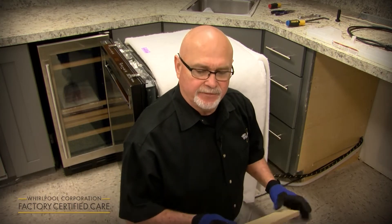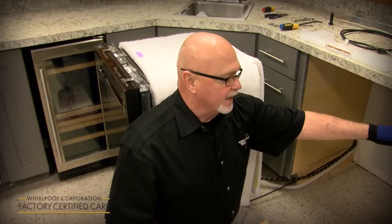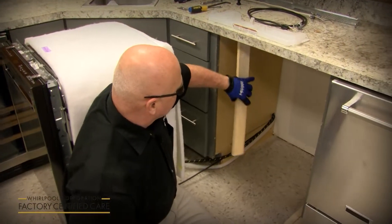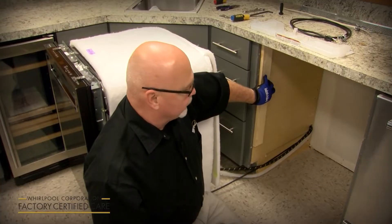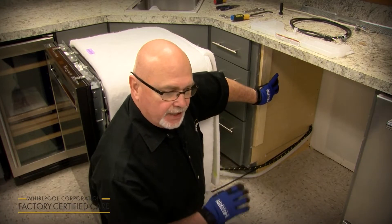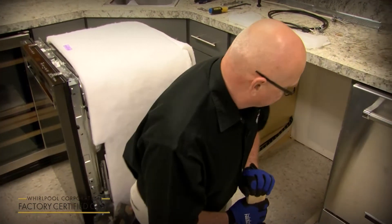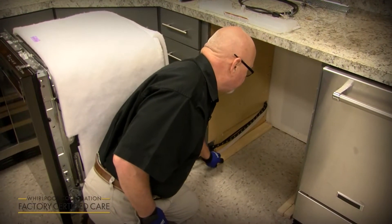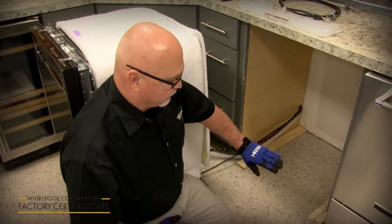During unpacking I mentioned saving the boards from the shipping base. If you've got an extra-wide cabinet behind the fascia board and you're side mounting, these work great as shims. For example, if the cabinet cutout is wider than 24 inches behind the fascia board, there's nothing for the screw to bite into — use the boards to shim both sides to 24 inches so the side anchor screw has something to bite into. On a built-up floor in an older home, use the full-length boards as runners so the dishwasher sits even with the floor and you don't get a gap at the top.